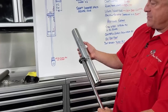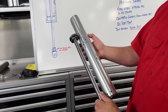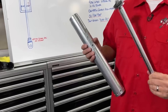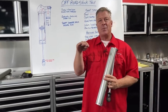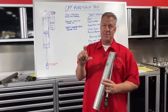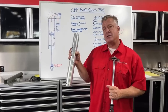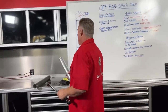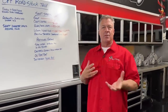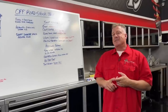If you add a lot of weight to your UTV without doing a spring kit, that piston is going to sit higher. It comes up and bangs right into the bump stage, which is super stiff right away. So even though you've added weight and lowered the vehicle — thinking it will bottom out easily — it's actually going to ride super stiff because that piston is in the bump stage at all times. The location of bypass ports is super important, and the total size of them gives you total flow, which is a tunable thing for ride quality.